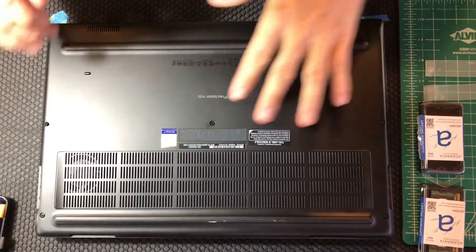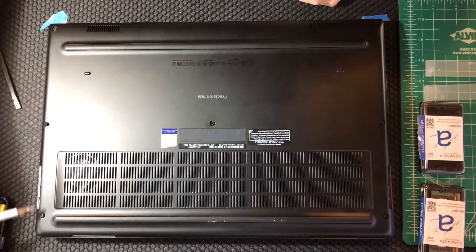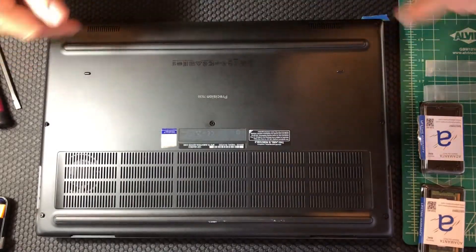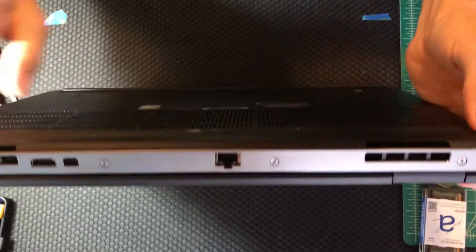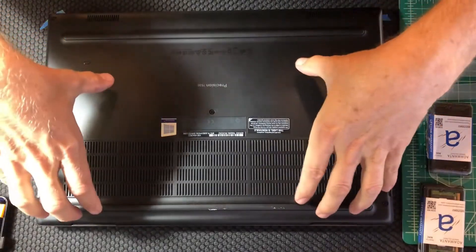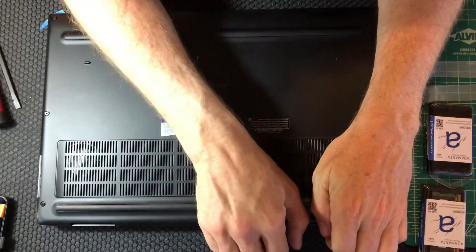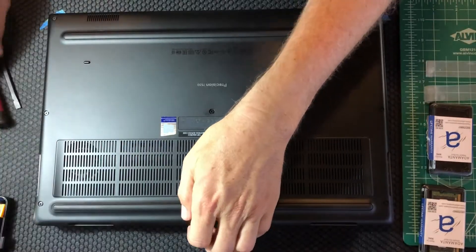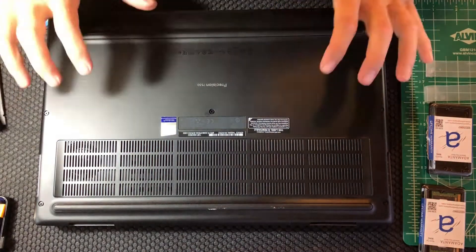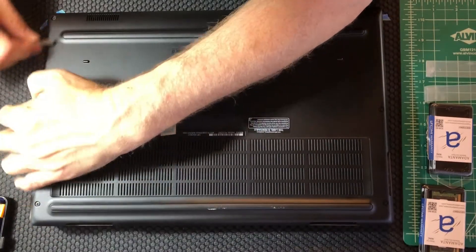Removing the plastic cover on the bottom is a little bit scary because it is plastic. You simply take out the six screws, which are captured screws — each has a washer on the underside that keeps it from coming out when you unfasten it. The manual says to use the two open slots at the top of the plastic panel as a pry point. If you lift on those spots you can feel the panel begin to come free from the snaps underneath. The spudger is really useful here. There's a crack in my case because the first time I did this I put too much torque on it and snapped it right there.